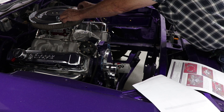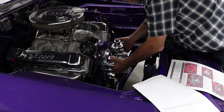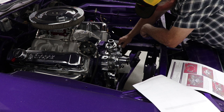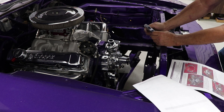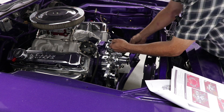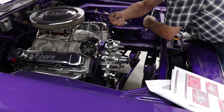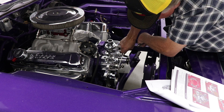We're going on with the water pump — just slide it on. In the pictures it shows the brackets going this way with the part numbers on the back. They give you four stainless steel threaded spacers with a machined surface on one end so you can put a wrench on them. Those machined squares are going to take a 5/8. I'll just torque this down nice and evenly.